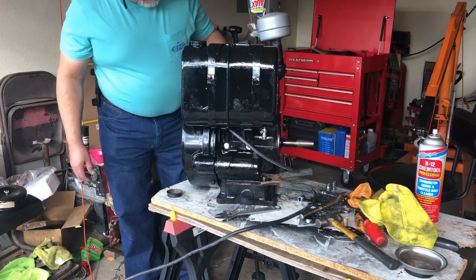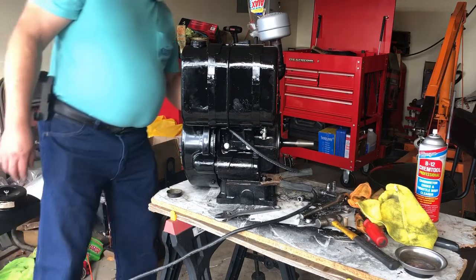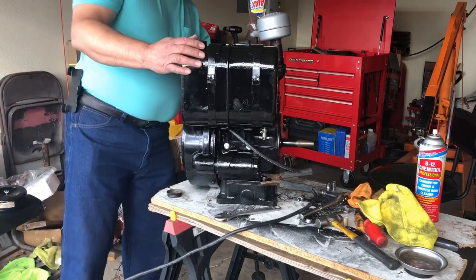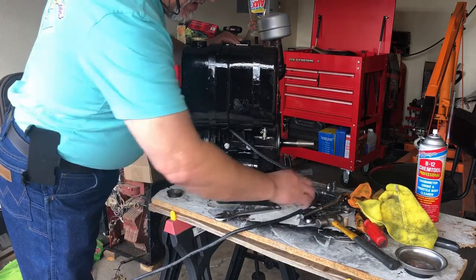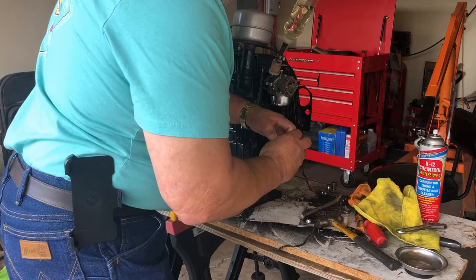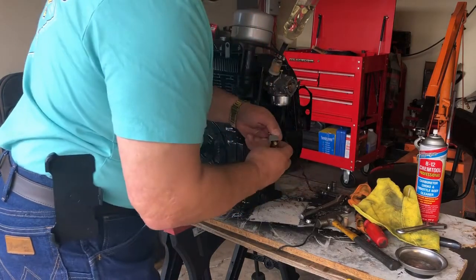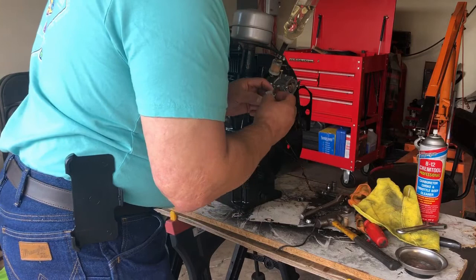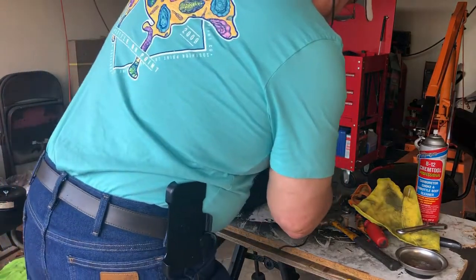We'll do that just to see if it's going to run. What I need is to get some wires hooked up over here on the points as a kill switch — I need to get my kill switch wired in. So let me get that set up and then we'll come back and try to start this engine. We've got to get this switch on there, which is the start switch. You don't really need to get power to it because I can put a jumper straight to that wire, but this is more for being able to kill it — to shut it off as needed.